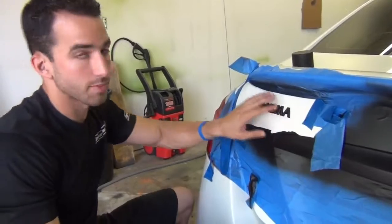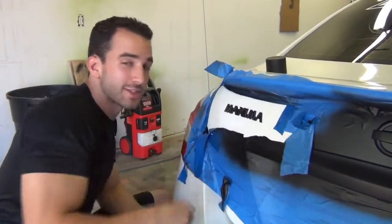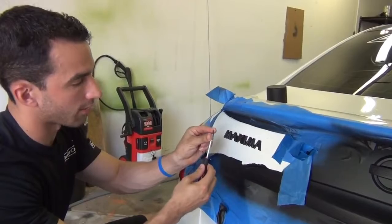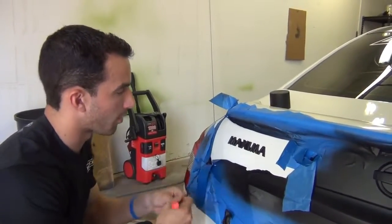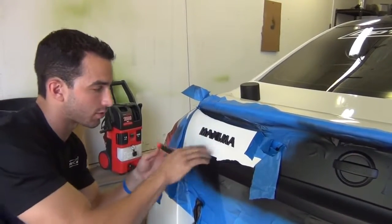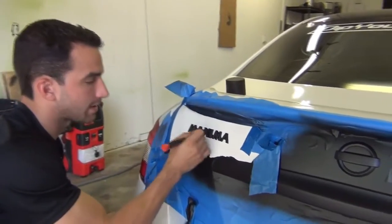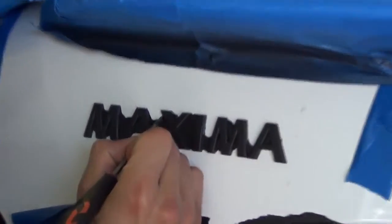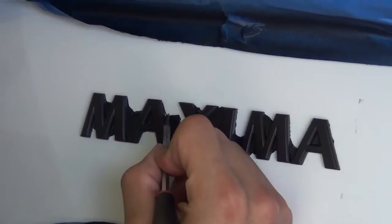Now we've got some dip left in between some of the letters and we want to use a tool to get in there. In the first video I did use a stick off the ground, but we've evolved a little bit. My favorite tool is a very small flat-head screwdriver — I've dragged it against the concrete a little bit just to take some of the sharp edge away. What we're going to do is use the flat edge of the screwdriver to drag the Plasti Dip away from the edges. Be careful — you could do some damage to your clear coat, so be really gentle. If you're not comfortable with it, you can use a toothpick. Just keep contact with the Plasti Dip and drag it away from the edge of the letter — you can see it pulls the dip away and it starts balling up in the middle.